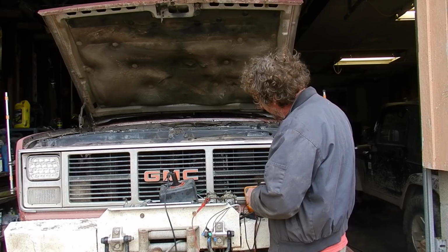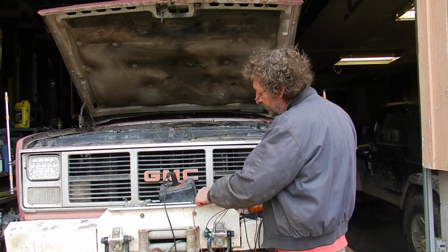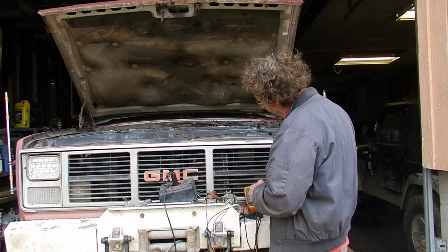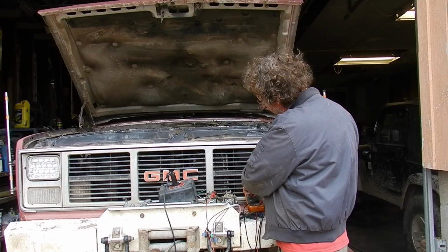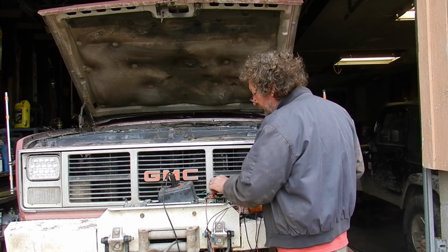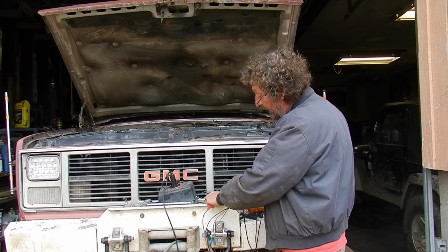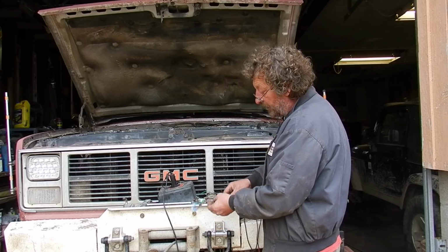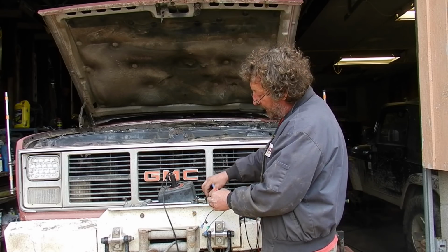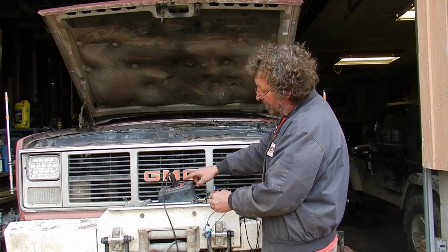And we're going to hit out. And we got 9.5 volts. Now we're going to look at the green one, and we're going to hit out. And we have 5/10 volts. So our black one has got the voltage in our out position. So that's the one that we want to hook the out wire to, which is the red. So we're going to hook the red to the same one as our black wire here from our plug that we installed before.